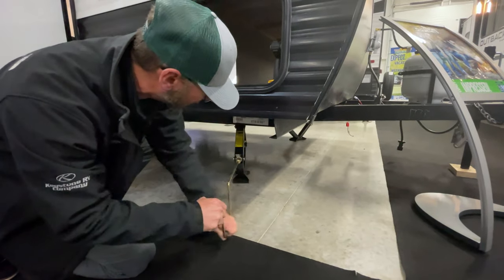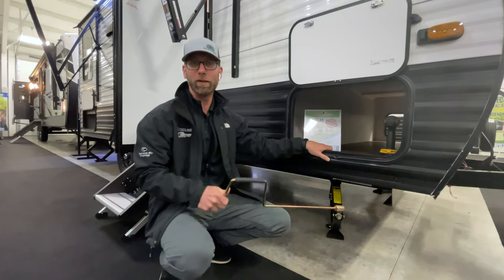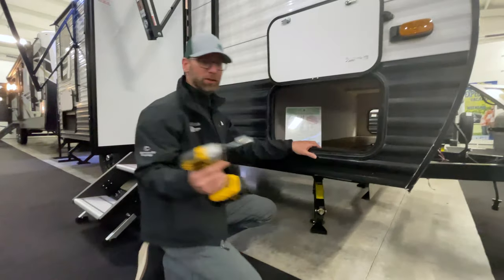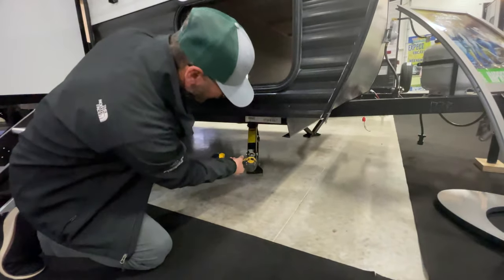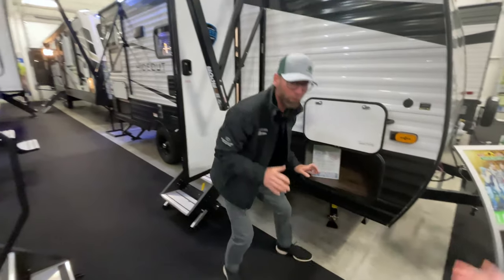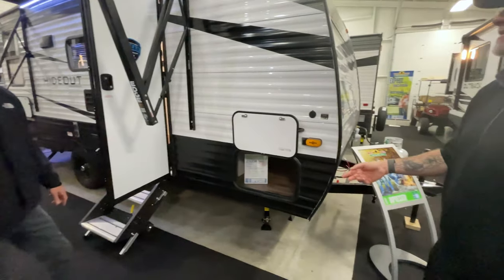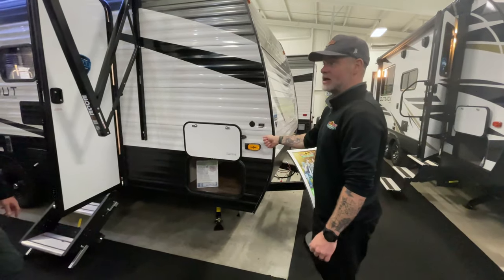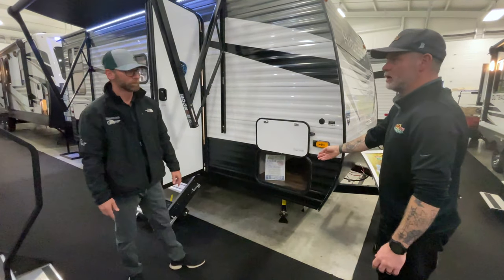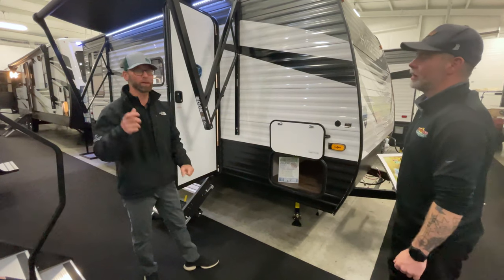With the manual handle, you just want to crank it down to your surface until it's snug and tight. A lot of folks aren't fans of going around the RV four times cranking manually, especially if the terrain is elevated in front and lower in back. What they'll do is take a half-inch socket and drill and simply run it up and down. Almost everybody's got a drill and a socket, so it's actually faster than electric. Throw it in your storage compartment and you're good to go.